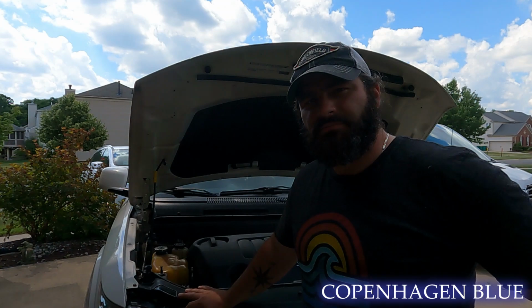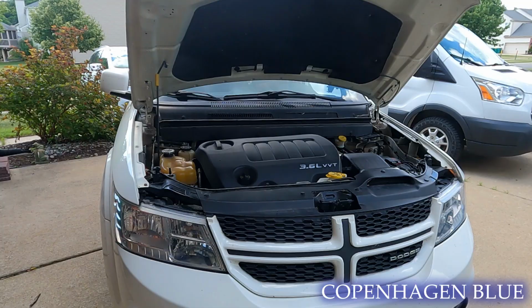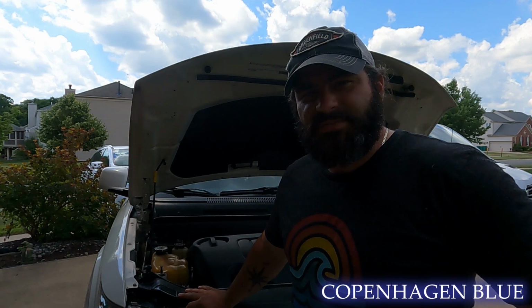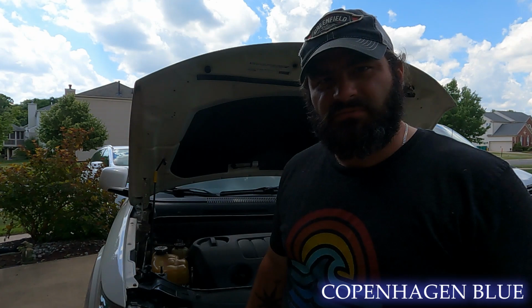You know what's annoying? This sound. Yeah, that sound right there. I don't like it. It's power steering whine, I think. I don't think the pump is bad, I just think maybe the fluid's old. So let's change out the fluid. It's easy. Let's get started.